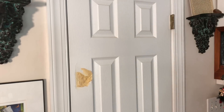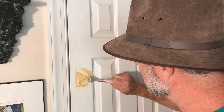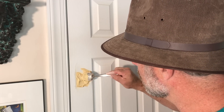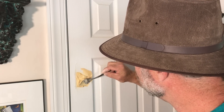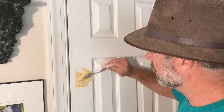After an hour, it's hard as a rock - just really really hard. We're going to go ahead and move on to the next layer. Get your putty nice and thick - a nice thick paste. Use your putty within about 15 minutes; don't make too much of it. Unless you have a really monstrous job, that should be no problem.